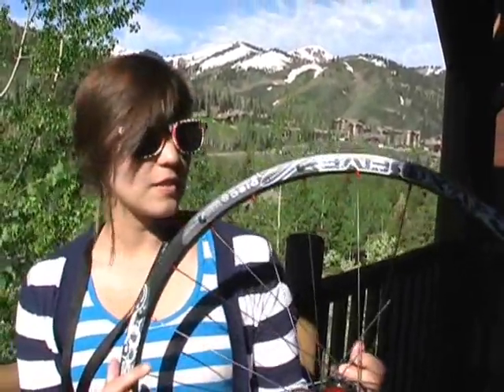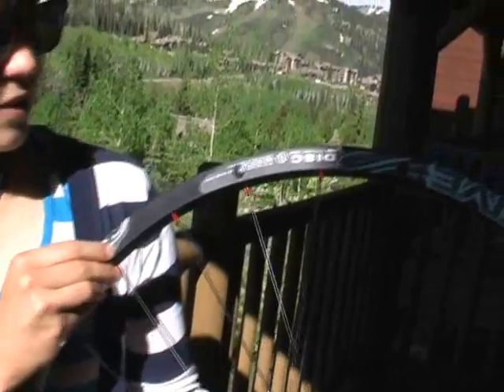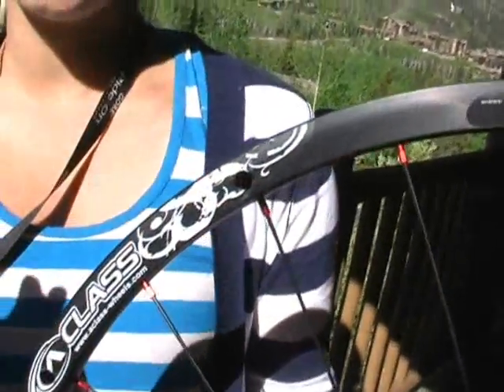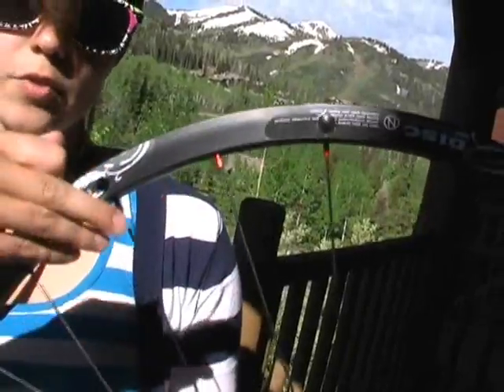The last one is our VXD5. This is an all-mountain enduro wheel, and it's really interesting because it's a tubeless wheel. It has straight pull spokes, and you insert the nipples on the side — there's a little rubber piece that pops out, and then you can put each nipple in individually, as opposed to having to put it in and then try to move it around.